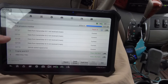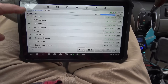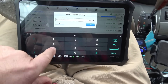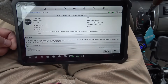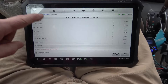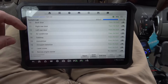It is showing that I do have some bad tire pressure sensors. I'm going to make a separate video on how to repair, replace, and reprogram tire pressure sensors. However in this video, everything else is beautiful. We can do a report on this — switch from kilometers to miles, enter the mileage at 79,550 and hit OK. What we got here is a 2010 Toyota Sienna. A total of 17 systems have been checked. One has a fault with a code count of five. That's not good, but when it comes to tire pressure transponders, that is the nanny state working with us.